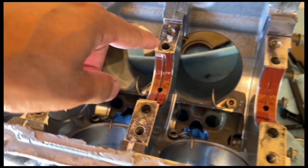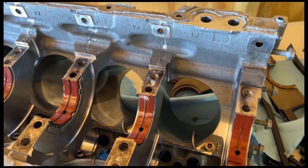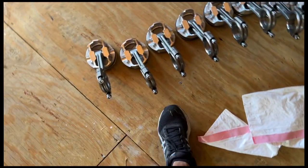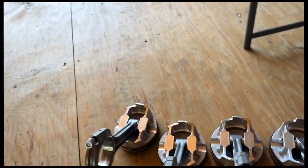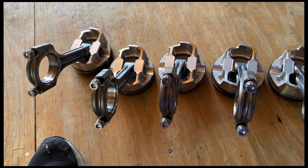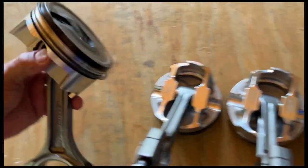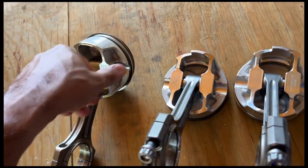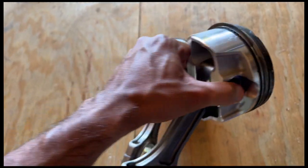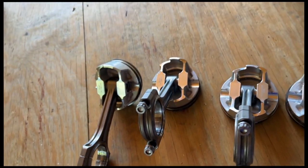You can still see the crosshatch marks in the cylinders from when I bought the engine — I'm the original owner, bought it brand new. Coming over here, the pistons are on the ground. I'm probably not going to reuse any of these pistons — as you can see, quite a few of them are chewed up. That one there is actually a pretty good one, believe it or not.